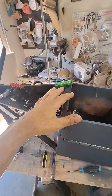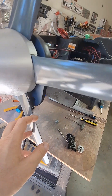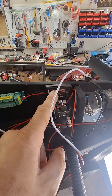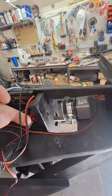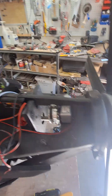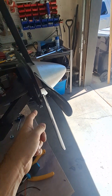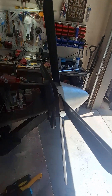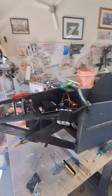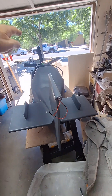The lighting is going to be as expected. You have two lights up here that will wig-wag, and we discussed they each flash independently. These flash based on this module, so you have 12 volts continuing through to this. Each one of these lines — there are two of them — is a lighting circuit. In this case, we have one going to green and one going to red. These same circuits will be divided up into these two front wig-wag lights, so they're going to flash in the same sequence. You'll have the wings flashing, you'll have the front flashing, and the back — if you want it flashing, you're going to have to switch this from just a constant hot power to that wig-wag circuit.